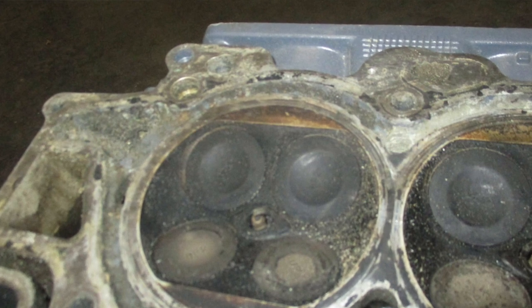The reason I like Salt Away for an engine flush — even in freshwater — is that it also inhibits aluminum corrosion. This is an open-loop cooling system on a PWC, and Salt Away inhibits aluminum rust. Aluminum rust looks like white chalk — really chalky — and it starts to collect and build up inside the engine.